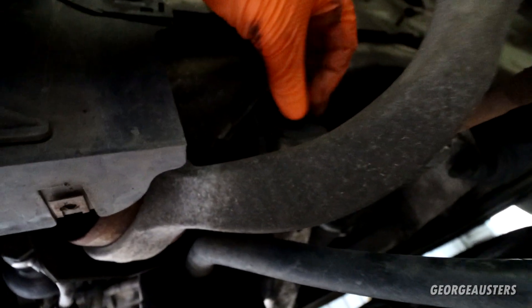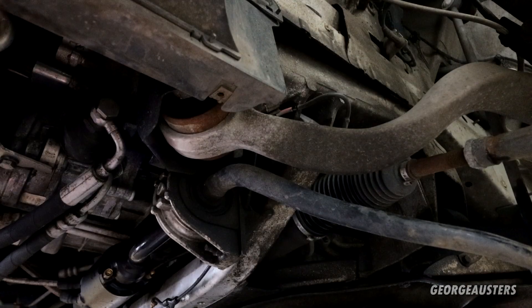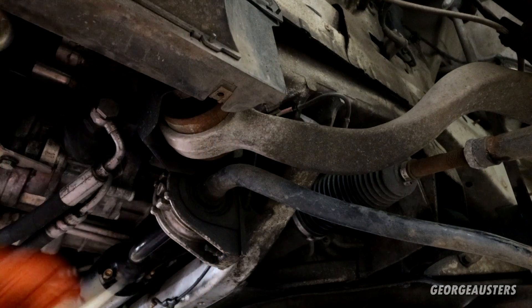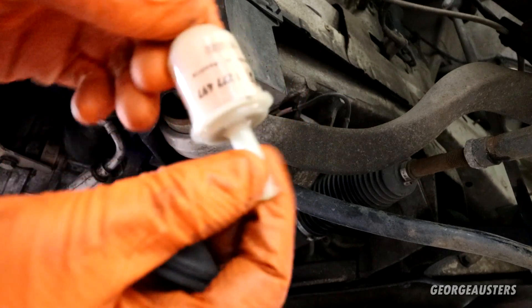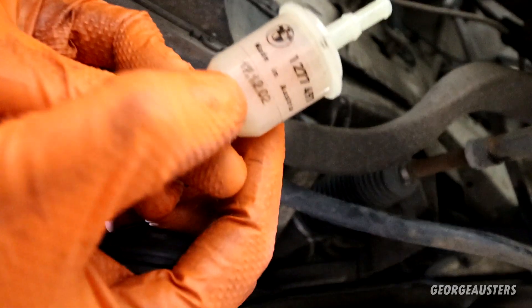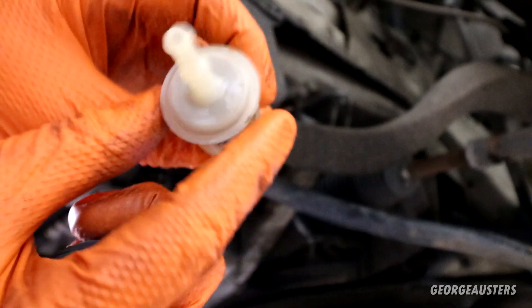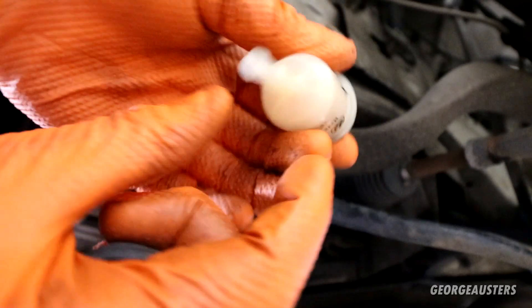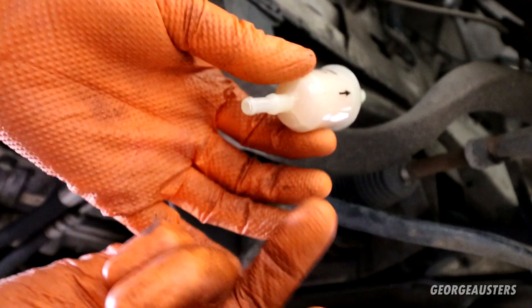We have these vent tubes — I'm going to keep these tubes but the little brass or copper fittings I have on the new anti-roll bar already, so I just need to loosen these and the vent tube should come off. We need to follow it all the way up, then remove this cap — there should be a filter behind there held in by a grommet, which is what we're replacing. I pulled the cap off and revealed the filter and grommet. The date on it reads 17th of December 2002 — so this is the original filter.